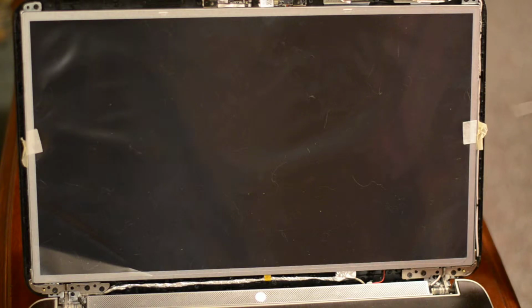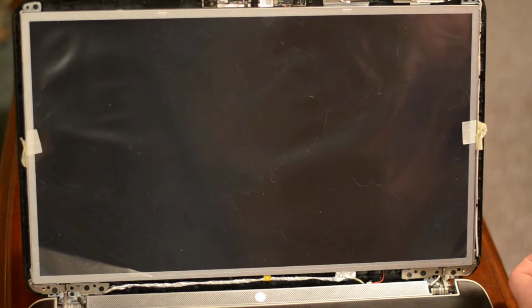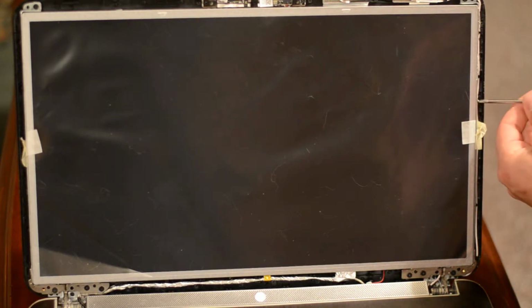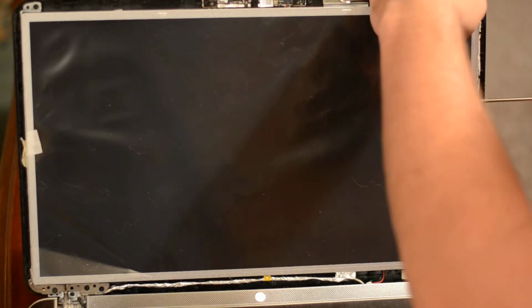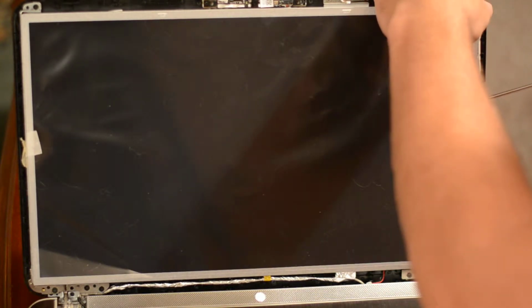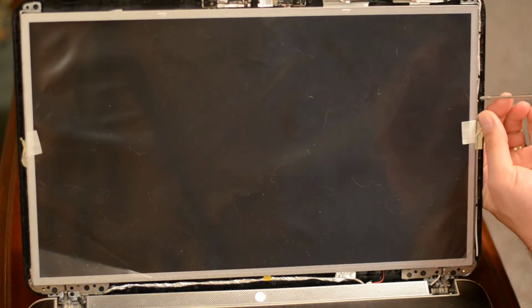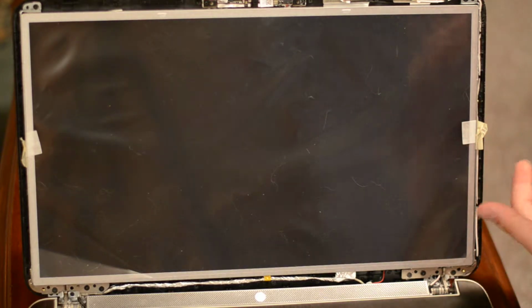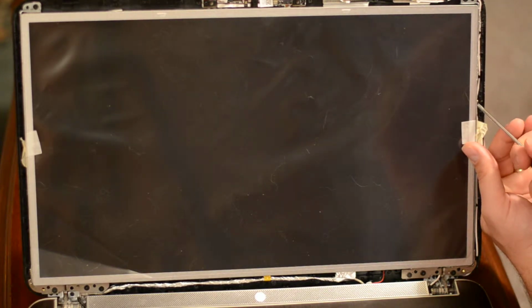Now you should just have to replace the side screws, which are very small. They're the smallest screws that you should have to remove. And again, I'm using a 0 Phillips for this. And so I had, I think, 3 in each side, and they were held in with Loctite. If you're worried about them coming out, possibly you can use, it looks like they used blue Loctite to keep these in. I'm actually going to skip that and just not worry about it, because I don't think they'll come out.